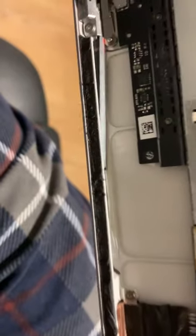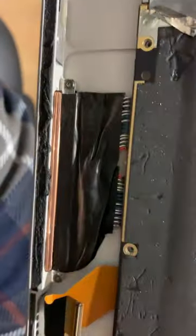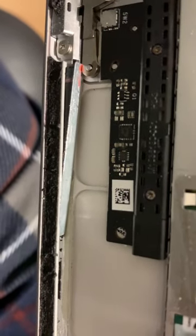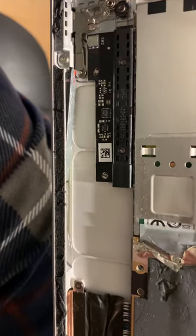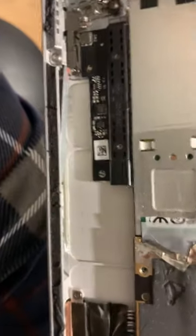The Surface Book 3 magnets that I'm showing you here have to be swapped out from the Surface Book 2 shell. So you have to take out the magnets from the Surface Book 2 and pop these ones in. I don't know if they just flipped polarity or something weird with the way they're lined up, but when you physically tried to push the two together, the magnets repelled each other. So I don't know if simply flipping them over would have done the job just as well, but I swapped the whole set of magnets, because it was easier for me to do that. So once they're glued in, everything will work fine.